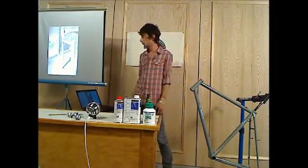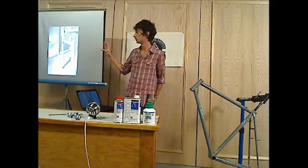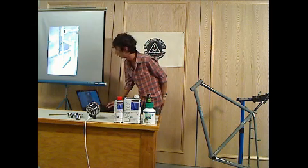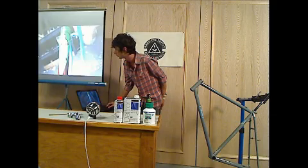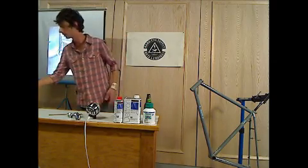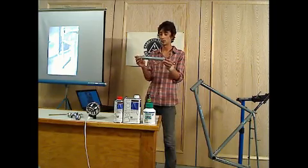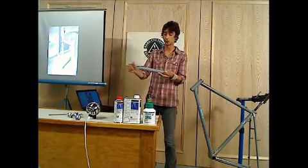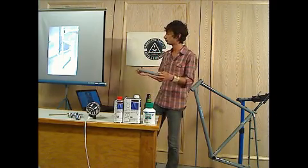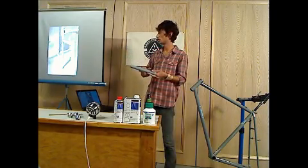over the entire thing. So for steel, there's usually two primers, an etch primer, like an anti-corrosion kind of primer, like this, which is very translucent. You can almost see through it. And then usually there's an epoxy primer over that. Now, I'm using a water-based system, where we just use this right on top of the bare metal. So if this tube was bare metal, then this is just the next step. I just want to prep and clean it and apply this coat, basically. Or you could do this method as well, and put the etch primer or the epoxy primer over that.